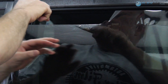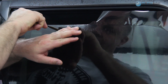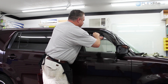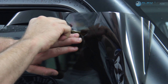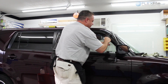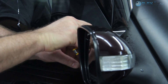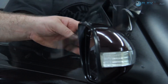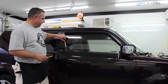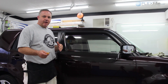I slipped a little bit — it's okay, I'm going to cut it again. I like this angle better anyway. I want to keep it the same all the way across, holding the film down. Now that we've trimmed our top edge and marked our sides with a Sharpie marker and our bottom, it's time to take the tint to another glass and do our final trim.